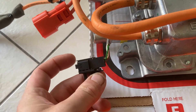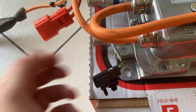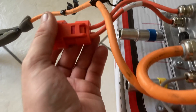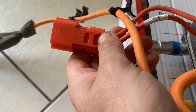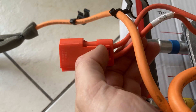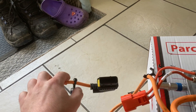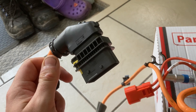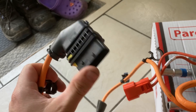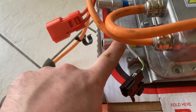This is just a normal plug — very simple. It just has a little tab on the other side of the connector that you depress and pull away. That one's easy. This one's the same as the other side — no safety tab on this one, but again you depress this part, pull it halfway off, then depress the red part and pull it the rest of the way off. This cable here goes down the side trim all the way to the back and has a kind of ECU-style plug.